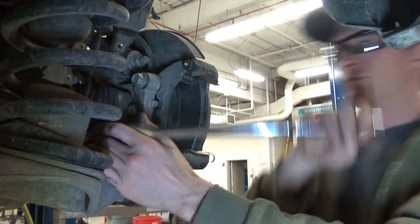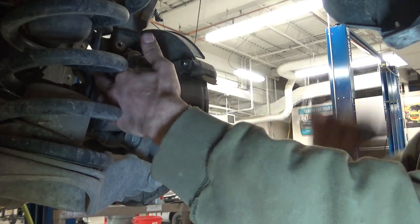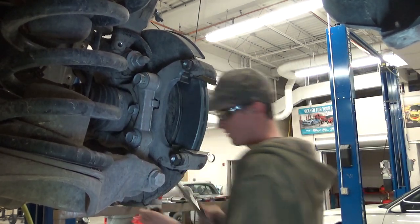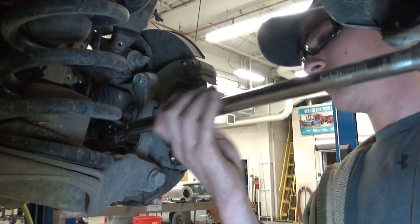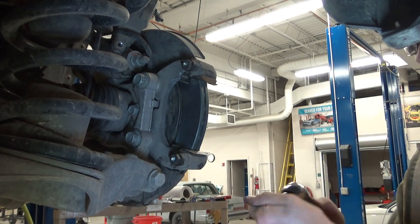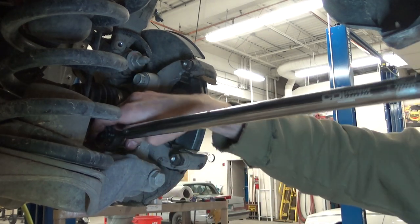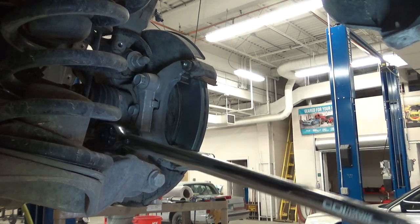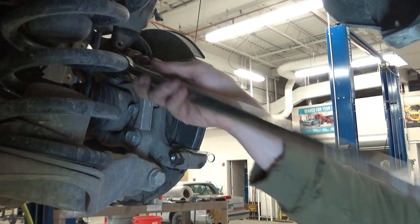Time lapse. Now, when I said tight, like in the front, I meant like 129 foot-pounds tight. So that's, oops, we're loose. Are we loosening? Oh, man. Tell ya, torque wrench got a mind of its own some days. Oh, yeah. There's 129 foot-pounds. Do it again. 129 foot-pounds.